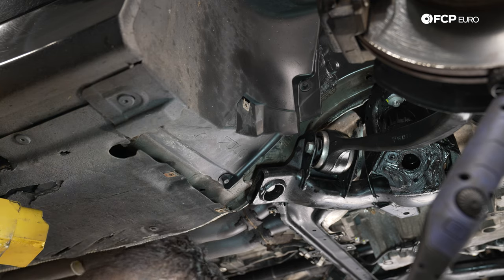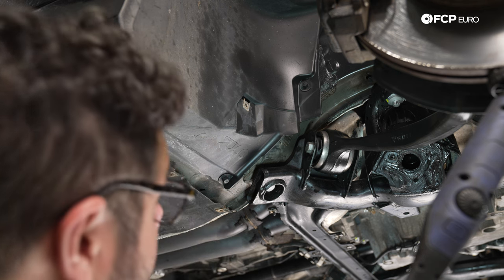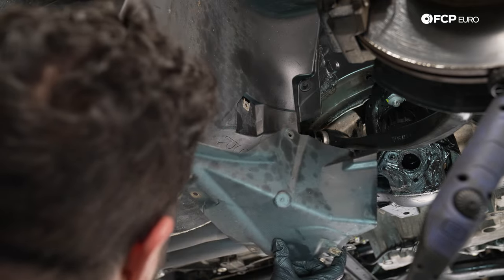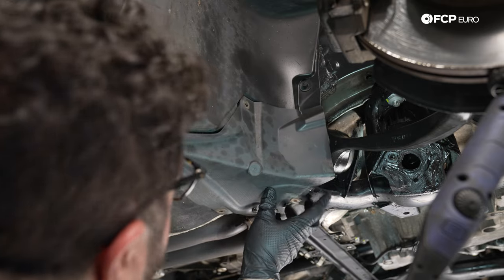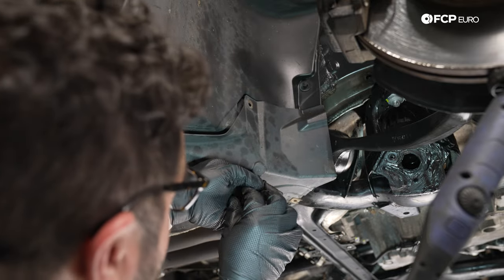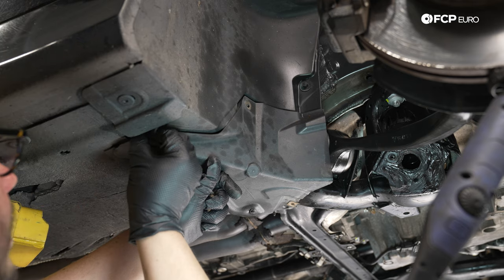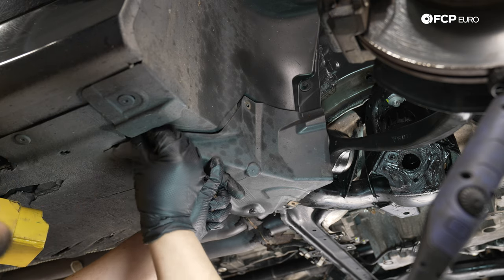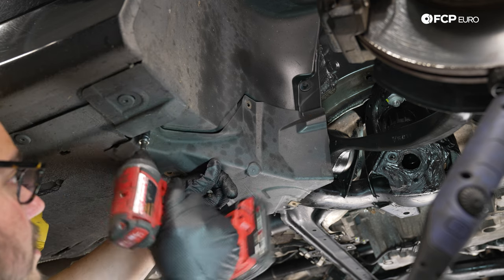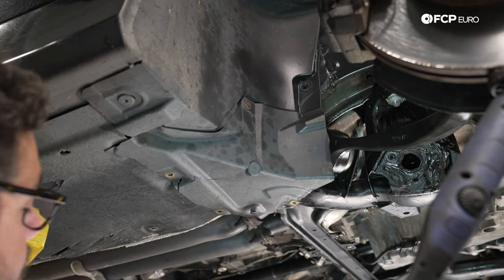My good people, we're gonna install the little corner half shield, half wheel liner pieces in first, as our bottom shields attach to those typically. So we're just gonna line these up, get these into place. We have a couple 8mm bolts and a 10mm plastic nut. The nut's towards the side skirt over here. We'll get that one started first with a 10mm on our small impact. Wonderful, then we'll switch over to our 8mm socket.